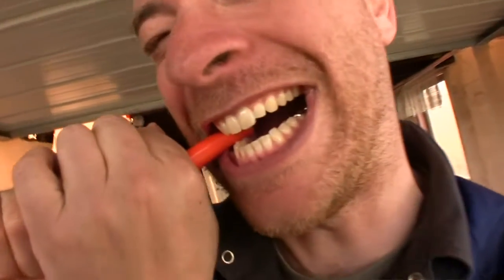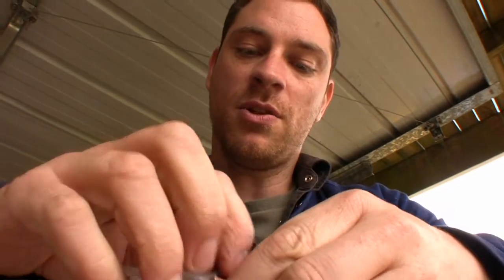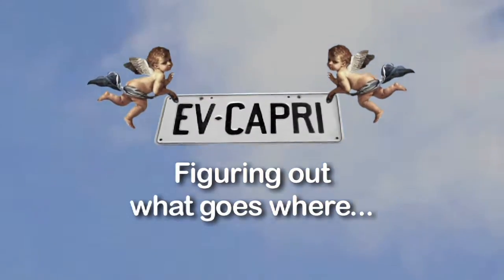If you've ever installed a home hi-fi you've probably stripped some of that little figure-eight wire - a lot of people just strip them and the little core comes out and you twist them up. That's not going to work with this stuff. You feed it all in there, keep pushing until it's all the way up, get your big clamp and it goes - and it never ever comes off. Then I'm going to get some heat shrink and put it over there, which is plastic tubing that when you heat it up it shrinks. So it will look beautiful and be totally safe and covered.